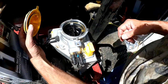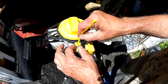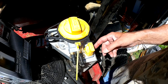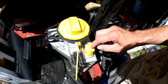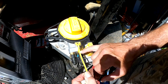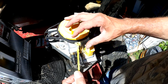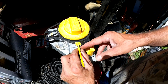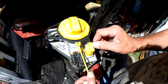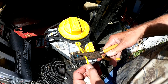Now we can put the cap back on. Bring it over here, align the holes, and we're going to put the little safety zip tie on here. If you get a half a quart or a quart low and want to add some oil, you're going to have to take this zip tie off. If you're careful, you can take it loose right there on that little tang and it'll pull apart with a sharp blade or a knife. I just recommend cutting it off, adding your oil, and then wiring this together or adding another zip tie — you get one in the oil filter kit. I'm going to cut most of that extra tail off.